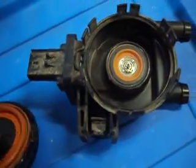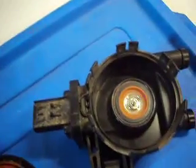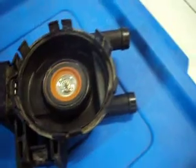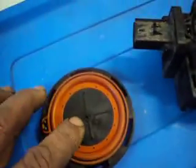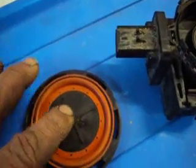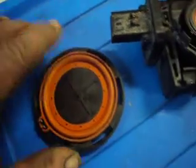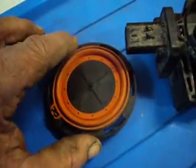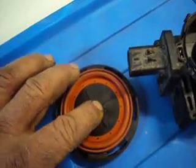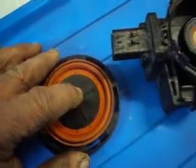Hopefully this will help explain a little bit of how this works. The large leak test is a little different — the PCM just activates the purge solenoid and then watches for a vacuum increase, and then sees how long that vacuum will last until the diaphragm is released. So it's just a matter of how much time it takes to bleed off to allow the diaphragm to be released.